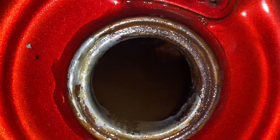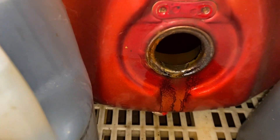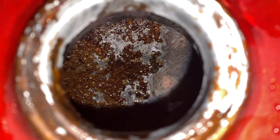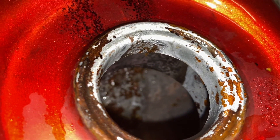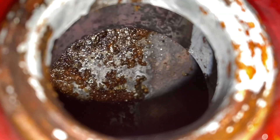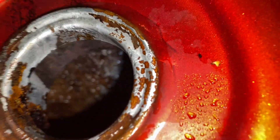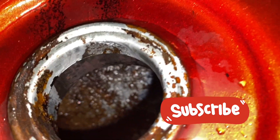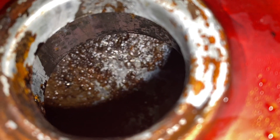We could see that other hole on the other side — we're almost up to the edge there. So I guess we'll just leave it as it is, that's about as good as we can do for the front. It started evaporating. So I'll dump this out and see what we get. This is going to need something better, but yeah it's cleaning up — it's starting to look better. Oh this was one of the worst tanks I've ever seen, so I can understand why it is taking so much work to get it clean. We're going to need to do something extra special to get this guy clean. So I guess we'll throw the Honda Shadow tank into this rotation and try and get that cleaned up.